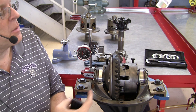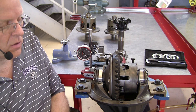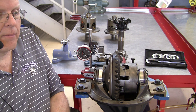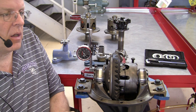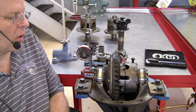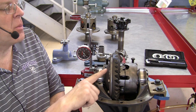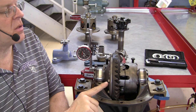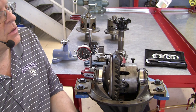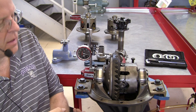This has been a demonstration of measuring the lateral runout on the back of the ring gear during the process of installation. You can also do this on disassembly, and you should do it on disassembly just to see where it's at, especially if you're going to reuse the ring gear. And as you may be able to see right here, there are two missing ring gear bolts, because as we discussed yesterday, two of the bolts stretched — and that brings this project to a halt also until we can get some replacement bolts.